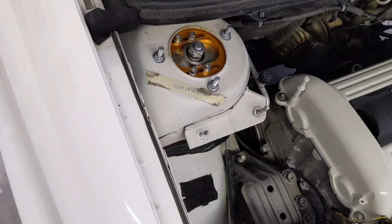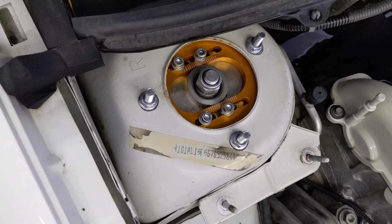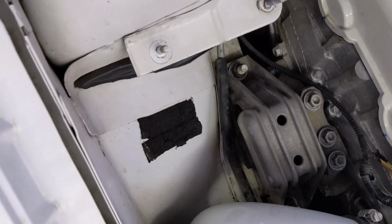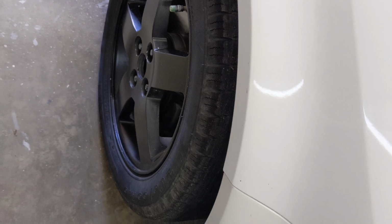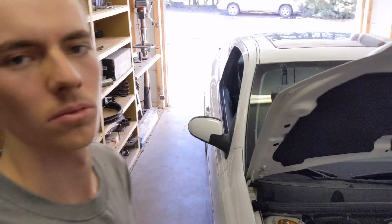I've got these, I think maybe I've showed those before, Cover Max spring rods, and Cover shocks in the front, and I actually need to adjust the camber. Not sure which way it is, but the tires are starting to wear a lot on the outside edge and not so much on the inside, so I need to fix that. Also need some new tires because these ones really sucked in the snow.